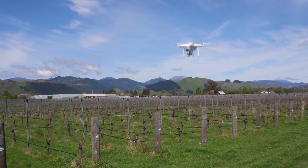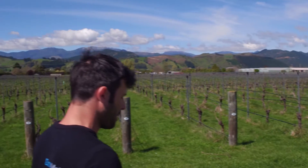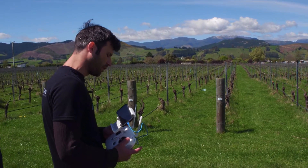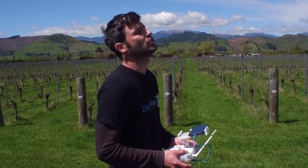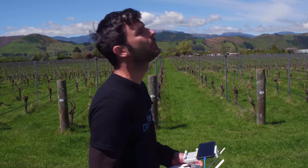It's good to keep your eye on the drone. At this time, if it does anything other than go up to its proper altitude — which is 200 feet — or anything that's a bit erratic, it's important to immediately switch from F to P mode. That will give you a position hold mode again with GPS lock, and then you can just fly the drone back manually.